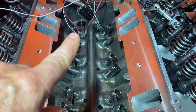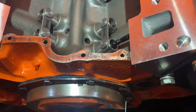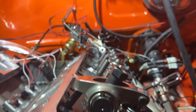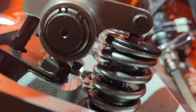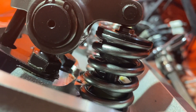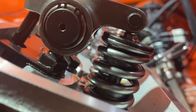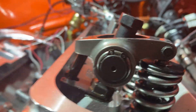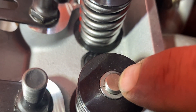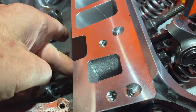Because I have my distributor out — which drives the oil pump — as I spin the engine, I know I won't be pumping this lifter up. Now ideally, the roller should be at this point with the valve closed on the one-third side facing the carburetor. You can see that it basically is there. And then when the valve is fully open, this roller should be on the one-third of the valve stem on the exhaust side. So you want it centered from closed to open, and that's what I've achieved with this particular pushrod length already.